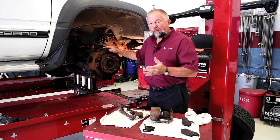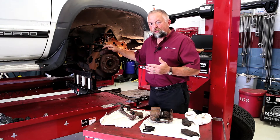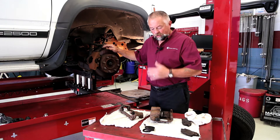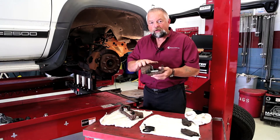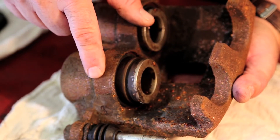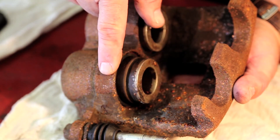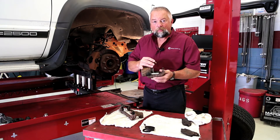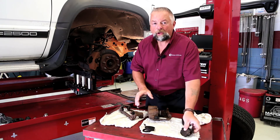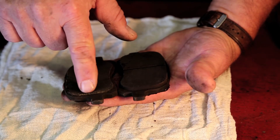In a mountain area it's a little different — you go through a lot more heat cycles because of all the braking going down the backside of mountains. With those heat cycles, a caliper's square cut seal can only absorb so many. Every time that caliper gets hot then cold, the square cut seal starts to get less flexible. The piston needs that seal to flex back and pull it in; if the seal loses flexibility, when you apply the brakes the piston comes out but doesn't get pulled back in. That causes premature or uneven brake pad wear — like where the inboard pad is worn almost to nothing while the outboard pad still has miles left.